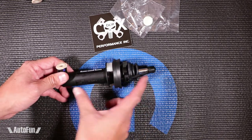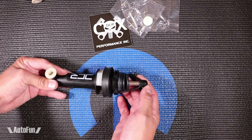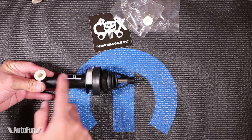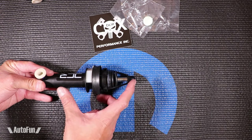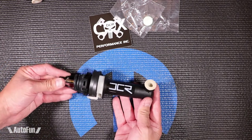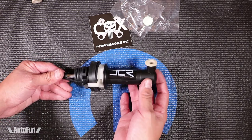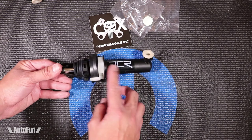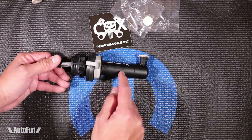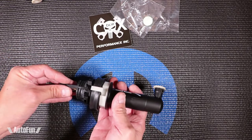I played with this and my original cylinder that came out of the car, and I pressed on it and the spring pressure felt about the same. However, this stuck out longer. So I think the spring rate internally is the same but maybe this is a longer spring, and that is what keeps the rattling from happening. Either way, I think this is the way to go. DCR seems to have very good prices — I'll put a link on the website. And I like the branding; I love branding especially when you have a cool logo. DCR didn't actually make this cylinder, but they took the cylinder to the next level, so now they have a really cool label on there and it's going to look neat when you install it in your car.